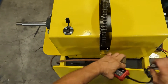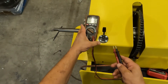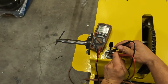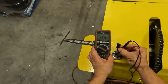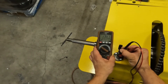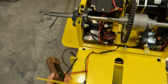Let me show you what to do if you're not getting that red charging light. This is where a multimeter comes in handy. Set it to DC voltage and we're going to test for voltage right here at the charge port. This connects directly to the battery through a fuse, so we can test for voltage here. I'm getting 13 volts, which tells me the fuse is good, the connection to the battery is good, and if I plug a charger here it should work.